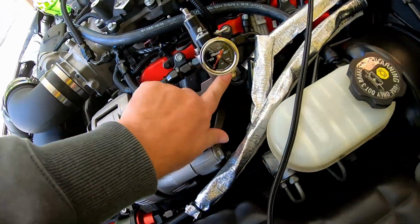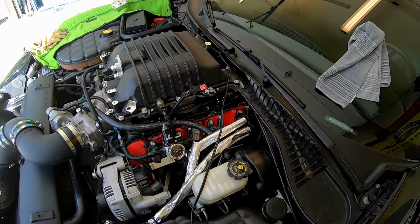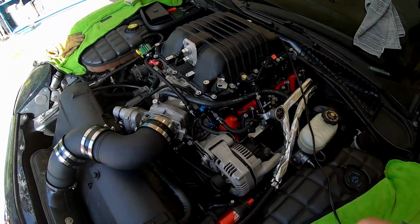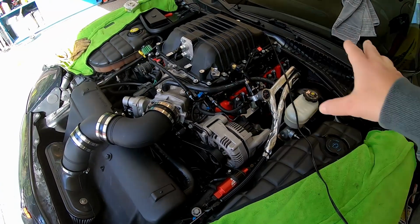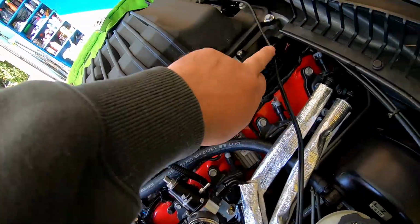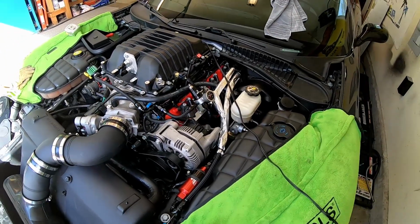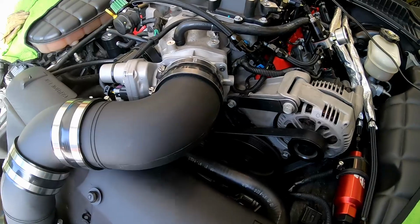That's got a swivel O-ring, swivel O-ring, swivel O-ring, swivel O-ring, and then the one over there has a swivel O-ring. I've pressurized it. I actually took the lines off the rails, capped this T, and then fed it into a jug and ran a bunch of fuel all the way out the end point of the lines to make sure there was no debris in there. Put it all back together, pressurized it, actually cracked one of these caps loose on each side on the fuel rails to get a bunch of air out of the rails, and we're getting closer to starting it up, but I gotta finish this damn power steering reservoir. So that's what I'm doing today.